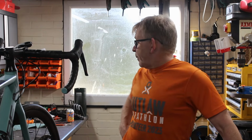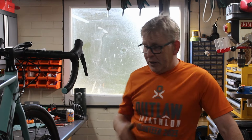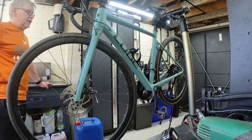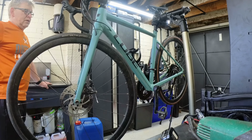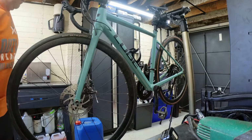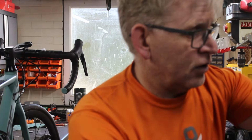So I had to get the hot spanner on it and the big persuading bar and that, and then got that off, and then I brought it up here and reground out the other side, which was also mangled as well, and then put it all back together, and then eventually got it to start by hitting it with a bit of carb cleaner, and it fired up first go, threw out a ton of smoke because I've had it on its side obviously, and the oil had run into the carburetor, and it's just run for an hour perfect.